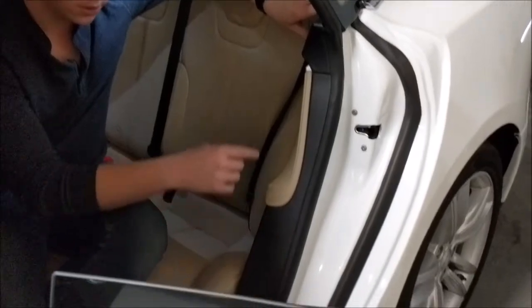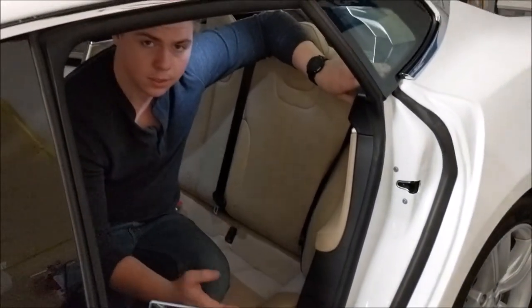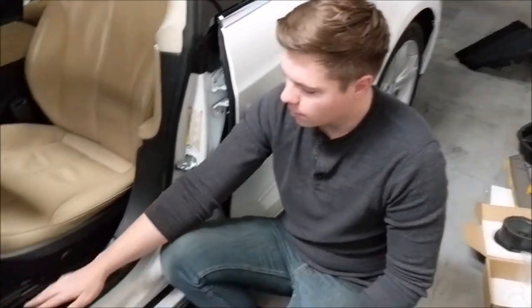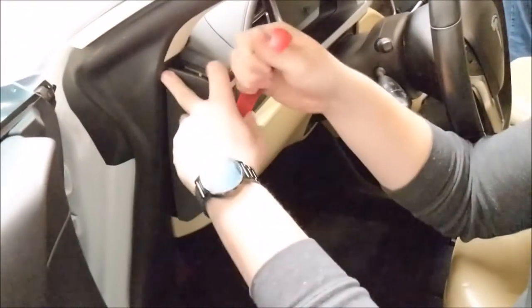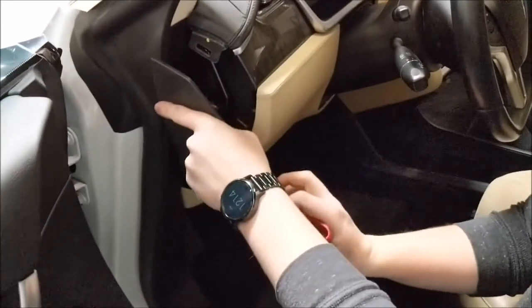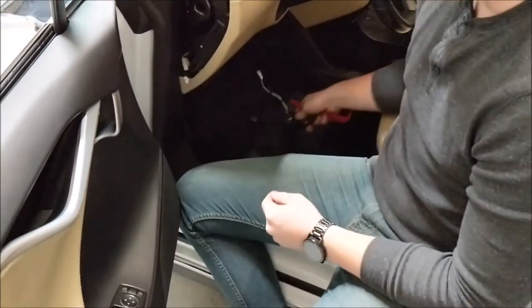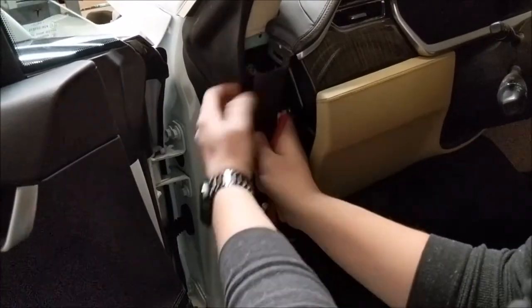Moving from the back to the front, you're going to route your wire between this trim piece and the car body, following the bundles of wire already traveling backwards. Depending on whether you have fishing wire or not, you may not need to move this piece — but if you have to, you can carefully lift it up as it's held in by clips, and that will assist you in feeding the wire from the back to the front. At the front driver's side, you're going to continue removing the bottom door seals. You're going to remove the piece down here, then start removing the upper piece. To remove the door seal component, grab your pry bar, apply gentle outward force, and be careful of the wire connected — go ahead and disconnect the wire.